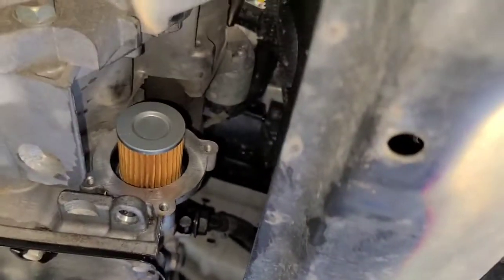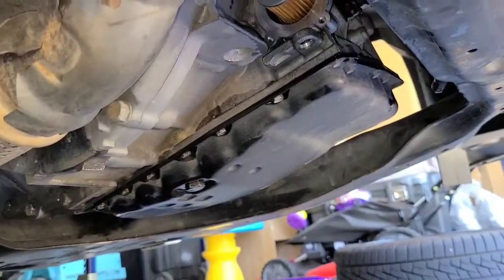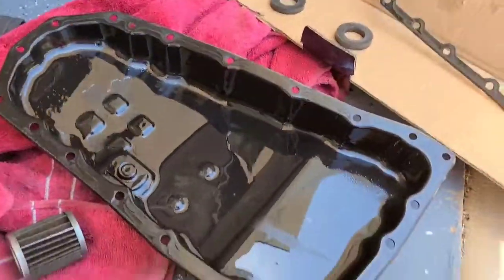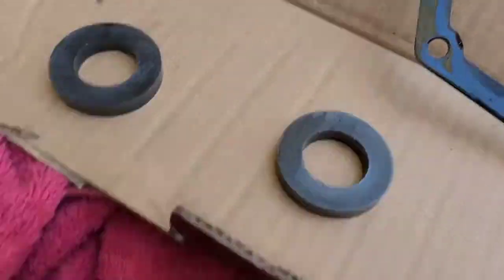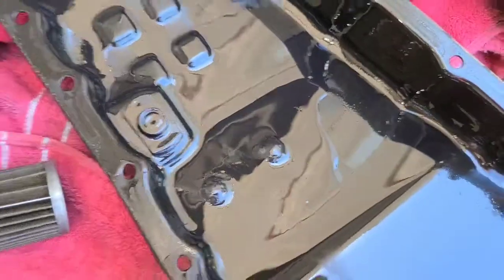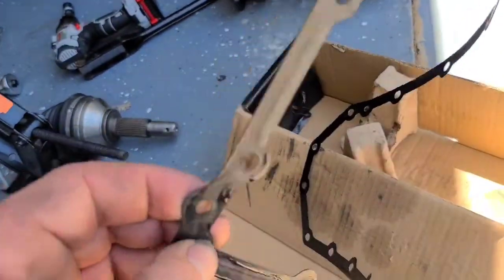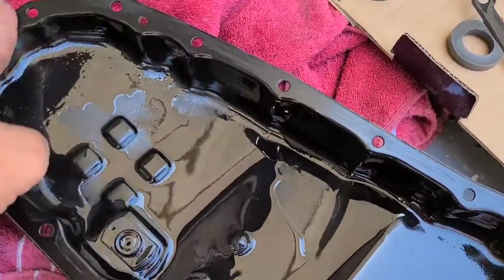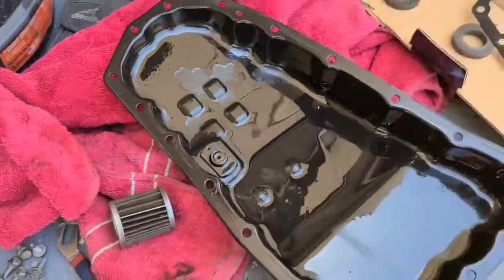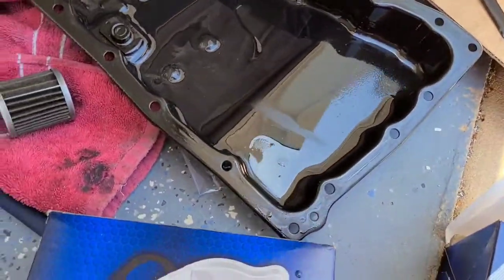Put the return line back on and close that up. Now we're gonna move on to the transmission pan. So I just dropped the pan. The gasket was kind of stuck on there but I put my fingernail in and the whole thing popped off at once. Those are the two magnets - they go right there and right there. I'm gonna clean that off, clean it out real good, make sure the edge is good. The good thing was the gasket came off all in one piece so it didn't leave any residue on here, which makes cleaning it a little bit easier. Just make sure you always clean it off real good. If you have to use a scraper, use a plastic scraper so you don't score up the pan or bend or dent anything, because if you do the pan is never gonna seal right.